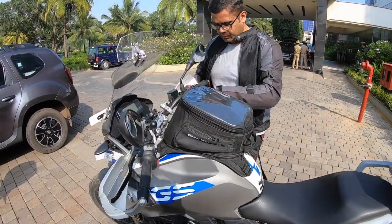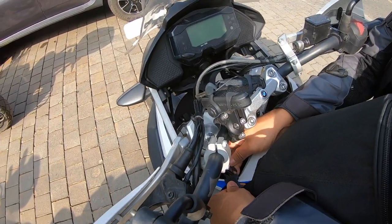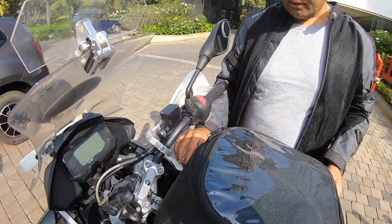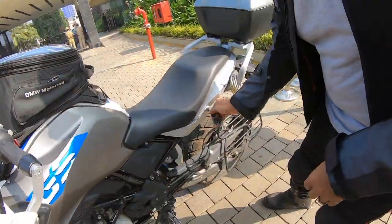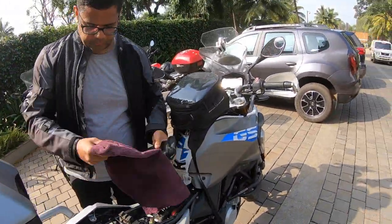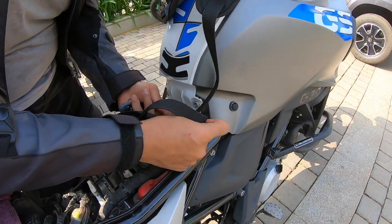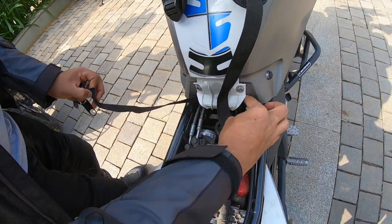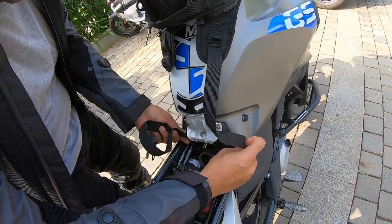First thing first, let me pin this down. It's just a clip — pretty sturdy and pretty good. In quality of course, it's a BMW original accessory, so you know the quality. I've purposely kept it with some play so I can adjust it later. Then all we have to do is route it into the seat. You have to hold this, take it across through this small slot right here, and it comes out on the other side. Make sure you have it positioned right. It doesn't matter too much about the exact angle. Check your bike's turning angle — you shouldn't obstruct any of those.